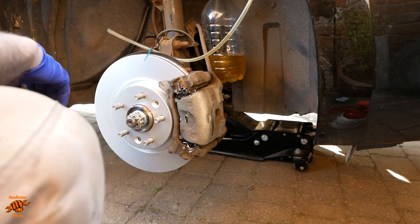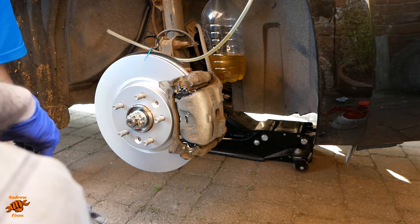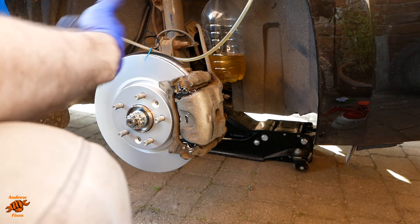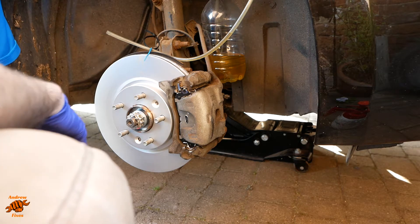Clean up, put the cap back on, onto the next one. There is a suggested order in the workshop manual: right hand front first, then left hand front, then right rear, then left rear. Make sure you top up the brake fluid reservoir as you go, because it'd be really annoying if you were to forget to do that and end up introducing more air into the system — I know because I've done that myself before. I managed to do the rear brakes without taking the wheels off just by leaning underneath, so hopefully you'll be able to do that too — it saves a bit of time. When you've finished, top up the reservoir again to the maximum mark; that'll make it easier to see if you're losing any brake fluid over time, although as your pads wear the fluid will drop down a little bit.